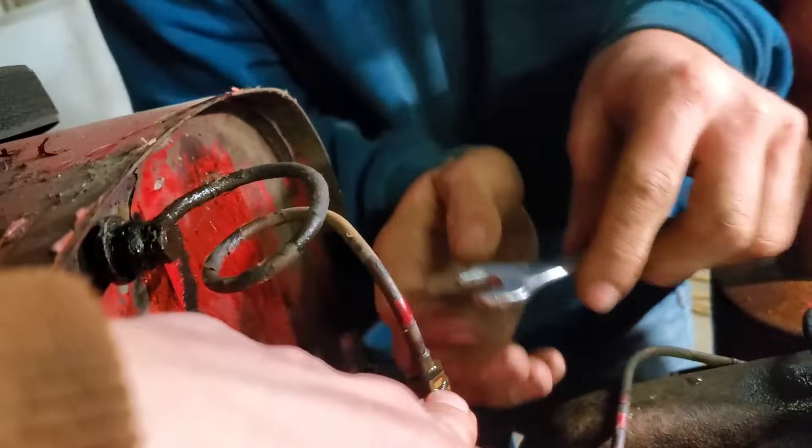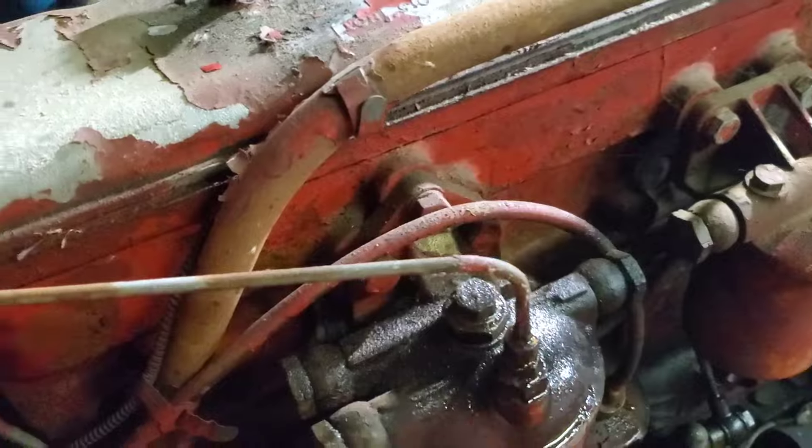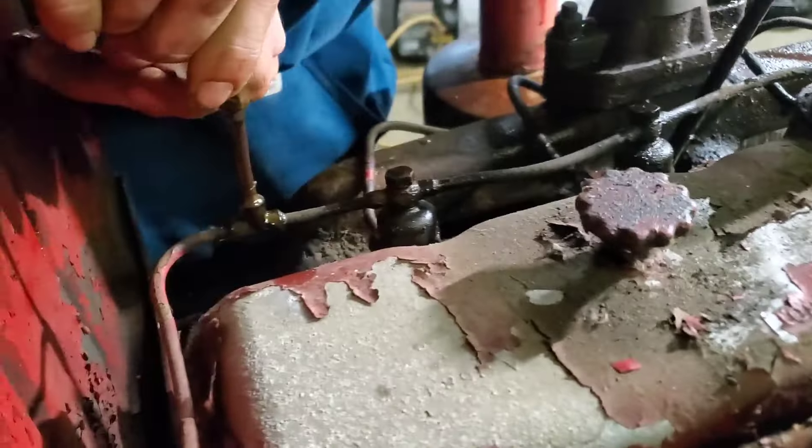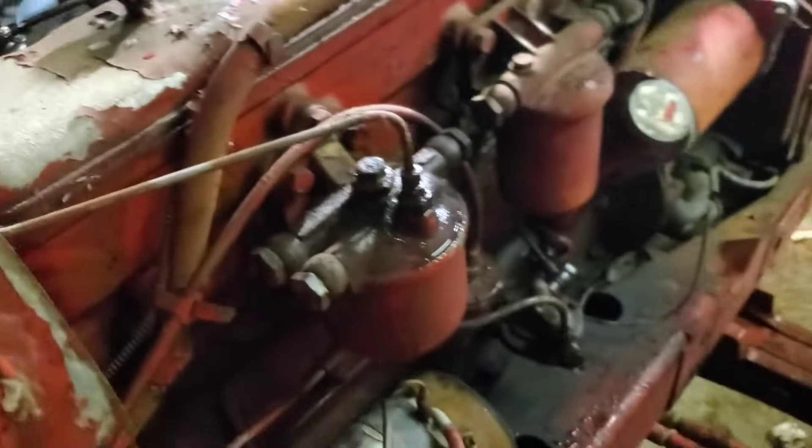On the leak-off, you need to take this guy apart which takes two wrenches — you gotta take that guy apart. I leave that till you get this, and then you gotta take it off the filter down here so that one doesn't get smacked. No way, that's scary that that's loose. It's like somebody tried to fix it but then didn't.